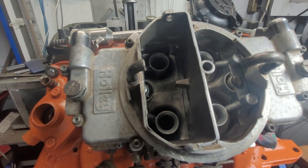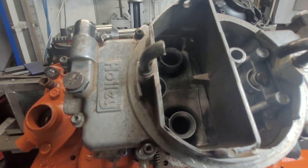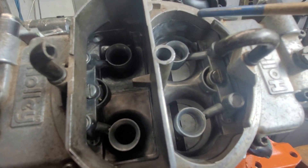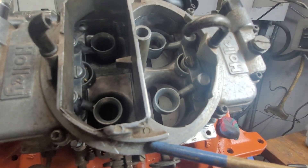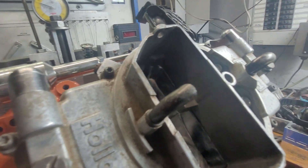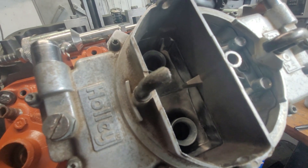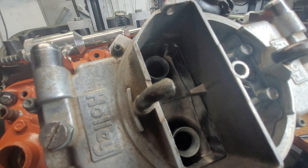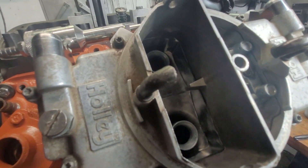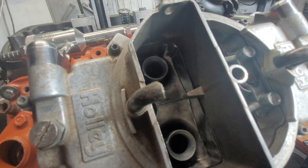So what did we learn in this little segment? When guys take this carb and modify it, the first thing they do is cut the choke horn all the way off — grind it right out and put a big fat radius right around there to get the air to go in a little bit easier. I used to do stuff like that to carburetors all the time and they made quite a big difference. I wouldn't say it necessarily made a huge amount of top-end difference — it made more tip-in difference, which I thought was strange. That's ancient history — that's 80s carburetor stuff, because in '88 I went to fuel injection.